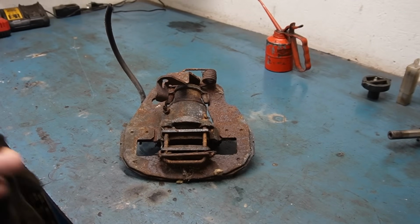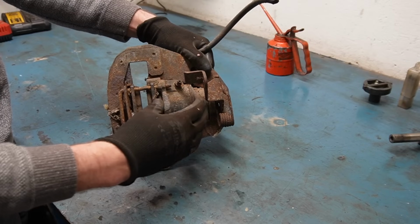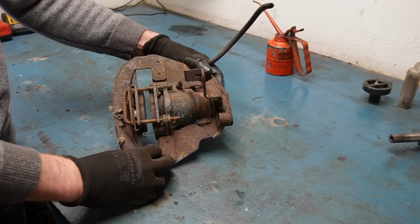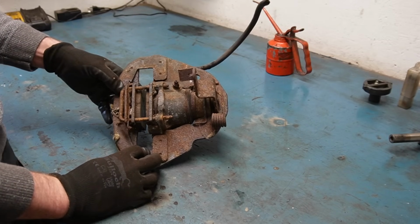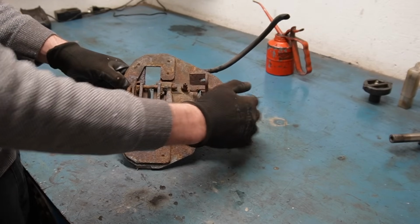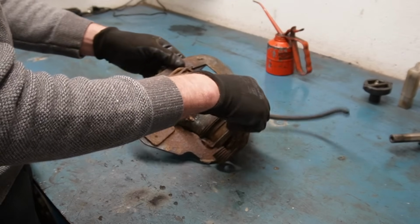The brake caliper is pretty funky. We got a caliper in here floating in a bracket. So it's only one piston, which is surprising in a way, because remember a Volvo got 4 pistons in this position. This one is more powerful but got 1. Then we got the handbrake mechanism also here. What we're going to start with is just to take everything apart.